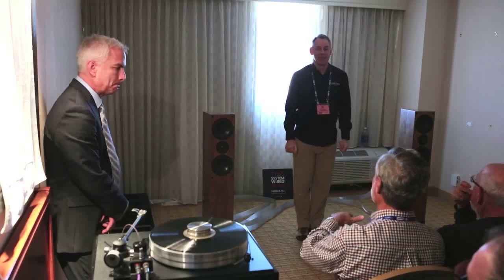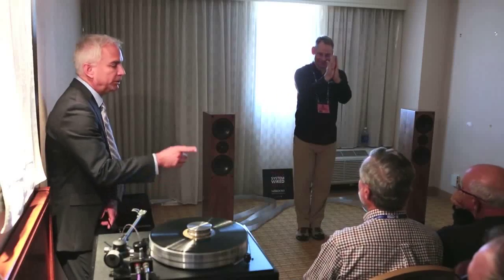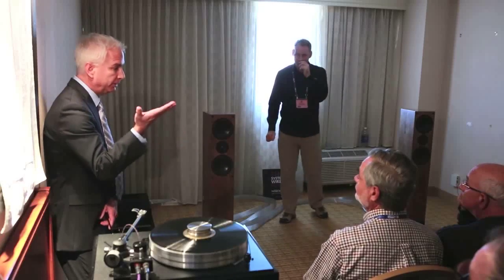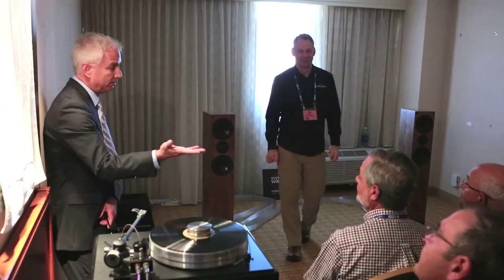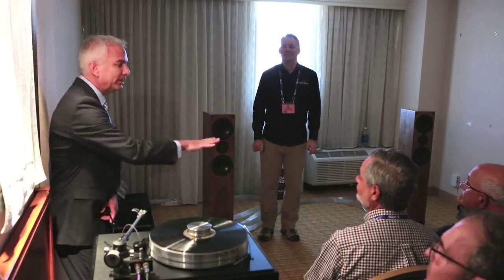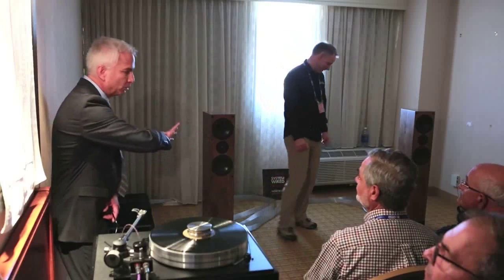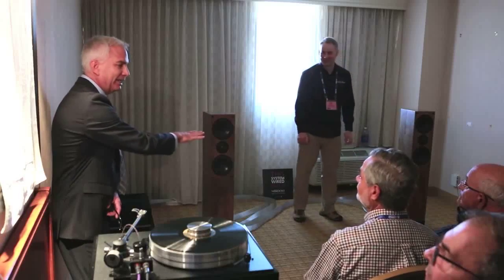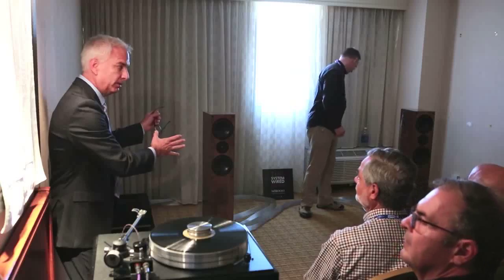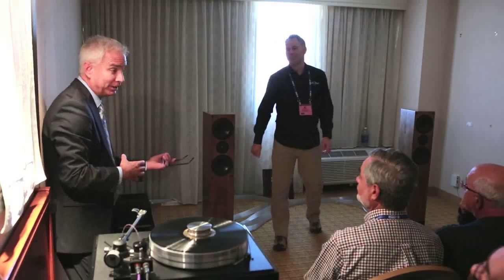When you change it back to the record, you're back. So all you're doing is coming in. And this is where it's important to compartmentalize how you listen. When you're listening to tracking force, you're listening to one specific criterion. Then when you go to SRA, you ignore that and only listen for SRA. And when you do azimuth, you ignore the other two and only listen to azimuth. And then you go back and only listen to tracking force. If you can compartmentalize it, you get away from the pitfalls of trying to change SRA by changing tracking force and things like that.